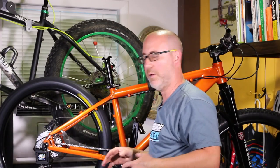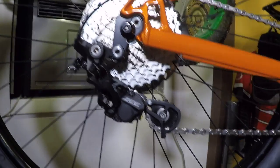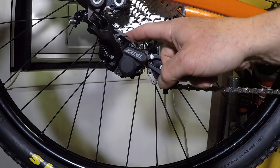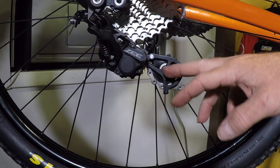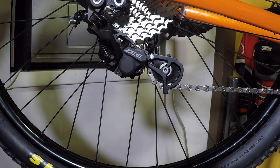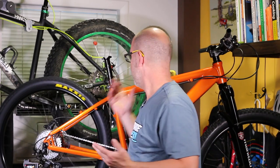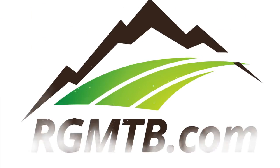I still have to tune up the rear derailleur. Let's see if our chain is sized correctly. The chain would be sized correctly if the derailleur has a slight bend to it — which it does. I'm also running a smaller cage derailleur, so I have a little more clearance. This chain is sized correctly, and it worked both ways: using two extra rivets and using the Chain Calculator app. We've got a chain installed on the bike! The next video will be tuning up the rear derailleur and finishing the last couple of things, and this bike is done. I hope this helped — I'm Gene from Wrangler Guy Mountain Biking. Thanks for watching and stay tuned for the next video. Have a great day.